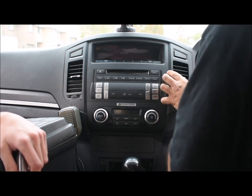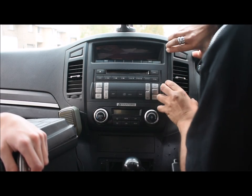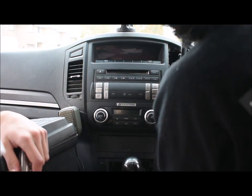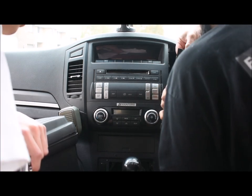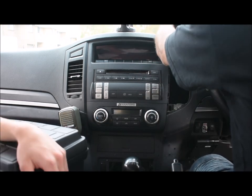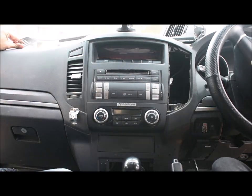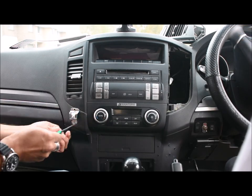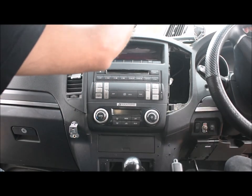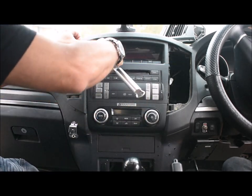Over here I'm removing the two air vents, beginning with the one on the right — I've sped it up a bit. That one does have a plug, which I think connects to the hazard light. It comes off with a simple clip. On the left-hand side I had the radio, and that's also held in by just three clips on each side — they snap out quite easily.